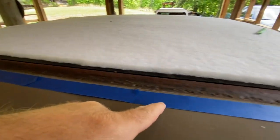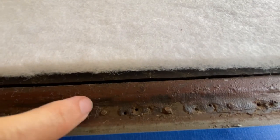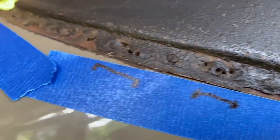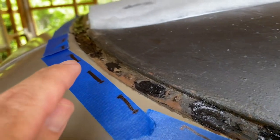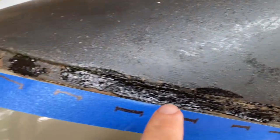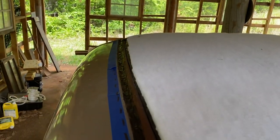Next I'm coming along with a strip of Easy Release Masking Tape so that I can mark the actual slots where the wood is, so I'm not going to nail into metal. I'm going to transfer those marks over to there — just knock the two ends and draw a line between. Next, take your butyl rubber and squeeze it into any holes that may be present to keep water from seeping in, after you have marked the holes so you know where to nail when you come back. Spread it thin — I've used a piece of plastic to rub it down and get it as thin as I can, but fill the holes as best as I possibly could.